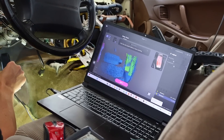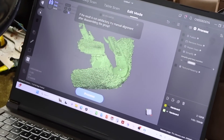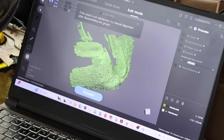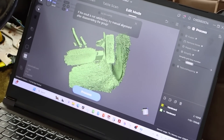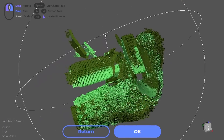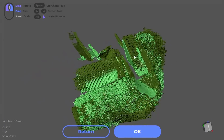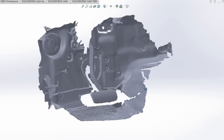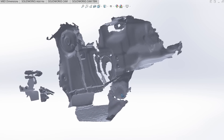This is what we got from the scan of the footwell — it looks pretty good. You can see the side that's more like leather, the carpet, and your two pedals. We can look at the scans in JM Studio software and can see we got pretty good resolution. From there, we're able to export it into CAD, which will allow us to make new brackets for the new pedals and get the exact placements we want.